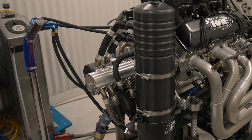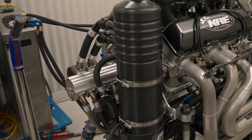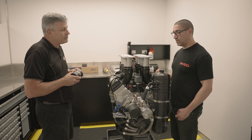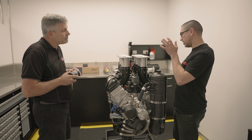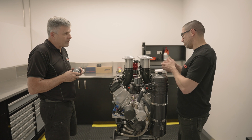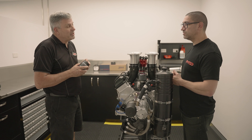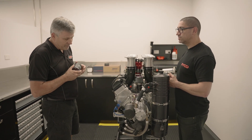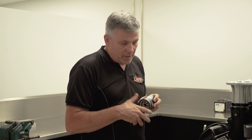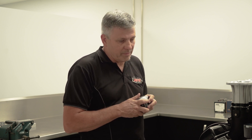You've got tiny fragments of titanium valve retainer and all those little things that come out of an engine that will be collected in the oil filter - a finer micron rating without worrying about the pressure drop. With all the effort that goes into one of these engines, if that part isn't up to the task, you pretty much ruin the rest of the engine. We've seen in the past where oiling system issues cause engine failure, which costs anywhere from $10,000 to $50,000. And in a road car with longer service intervals, the better filtration you have, the better it looks after the motor.